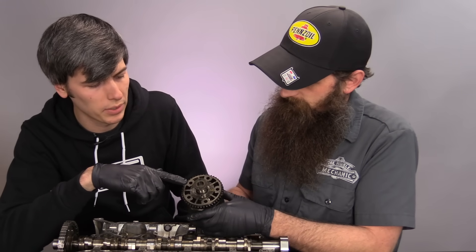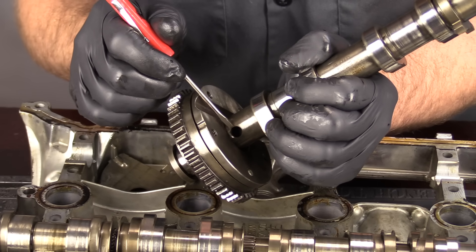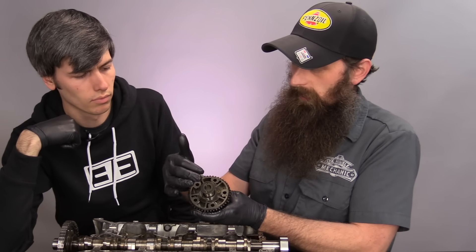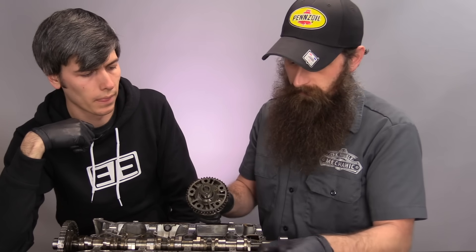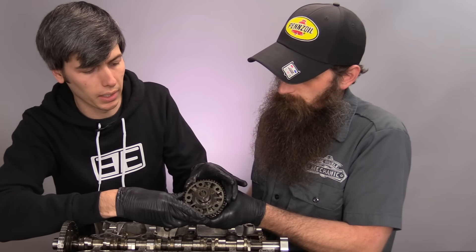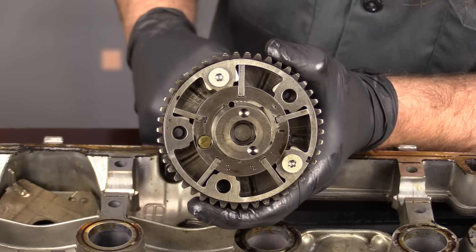This oil will fall down the timing chain side and reset back to zero. So all you're doing is filling either one side with oil or the other side — they both have a port and you can drain it out the back. On the timing cover there's a solenoid that controls this, and it's a spool valve with different chambers and ways to pass oil through. It's worth mentioning that the cam gear is remaining stationary — the cam shaft is rotating in relation to it. The actual shaft is rotating, not the cam gear.